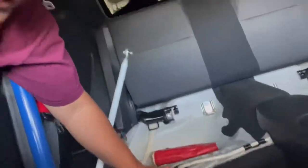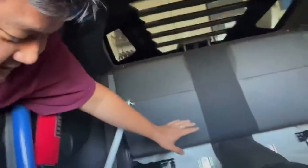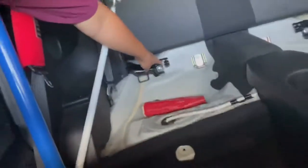I might as well teach you guys how to take out that back piece, so let's get to it. First you need to take out these rear seats — they all have a little bolt right here which is 10 millimeter. Use that for each side, then push down on the seat where the clip is and it'll pop right up.